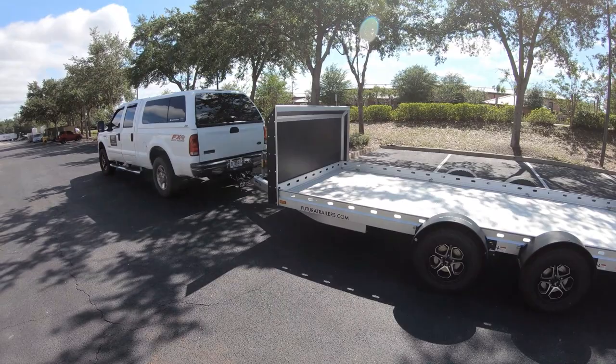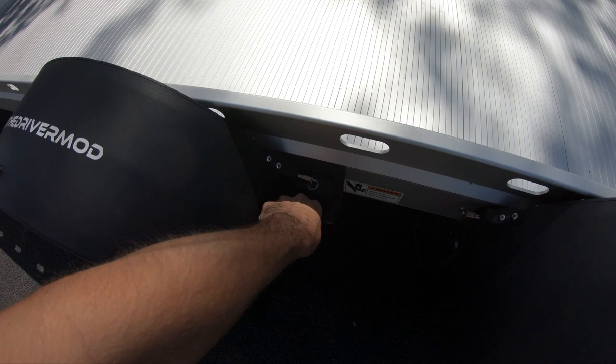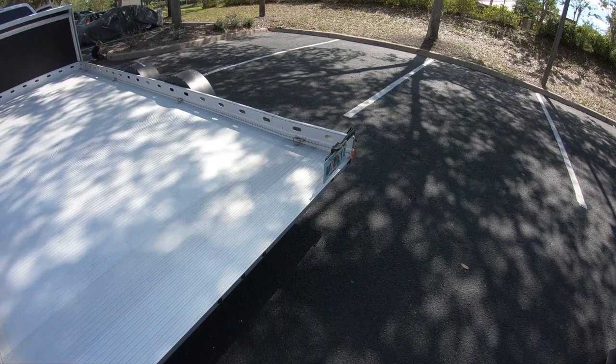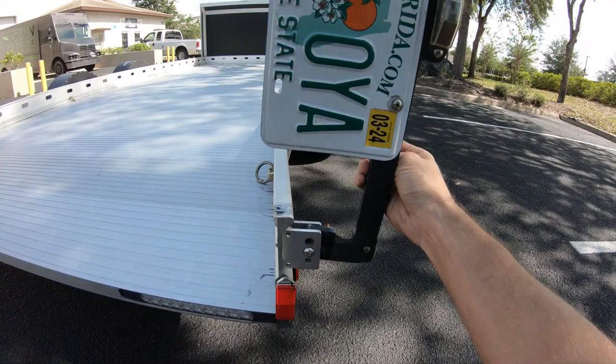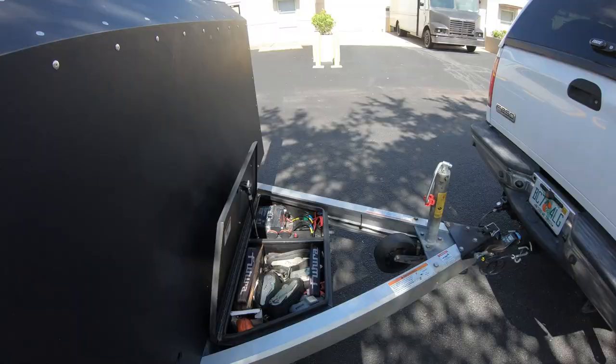You don't want all the weight of the vehicle on the trailer jack, so we've got it hooked up. First thing you're going to do is pull the wheel arch locks. While you're walking around behind the trailer, you're going to release the license plate and fold it up and lock it. There are two more wheel arch locks as well.